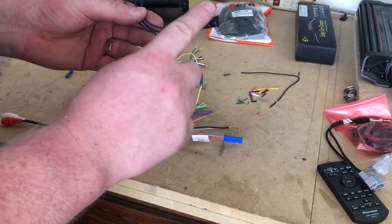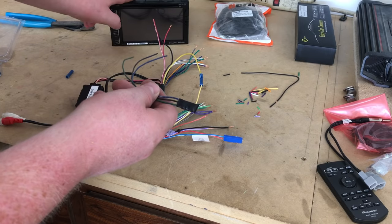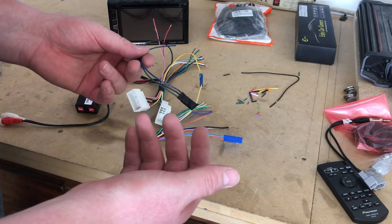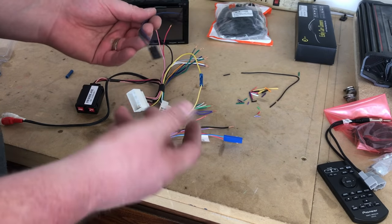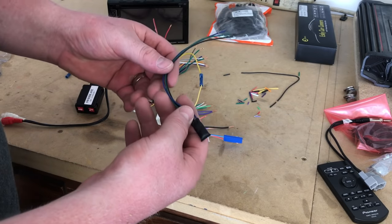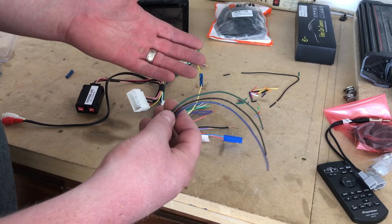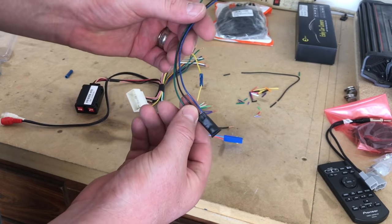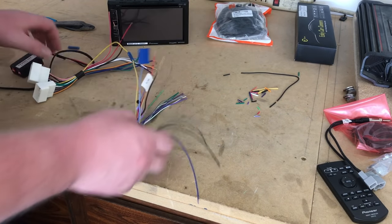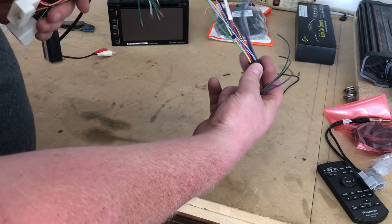Keep in mind this provides a double pulse negative signal, which is what Pioneer needs. Other models like Alpine require something a little bit different. Kenwoods are beginning to come around to needing their own bypass, but some of the older ones you can still just ground out — it really depends on the radio. So we're gonna get this wired in and show you how to do so.